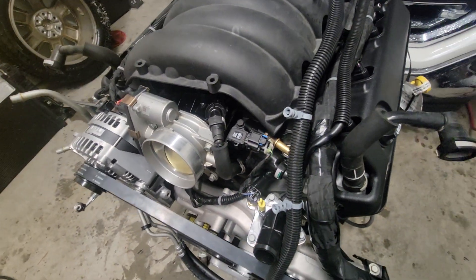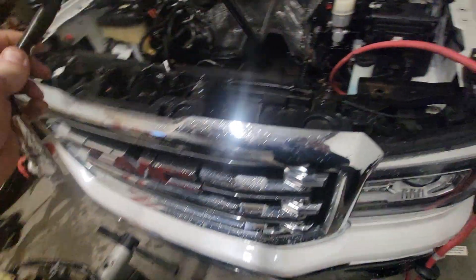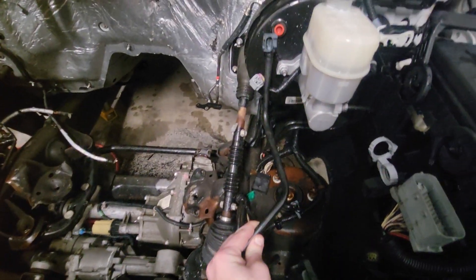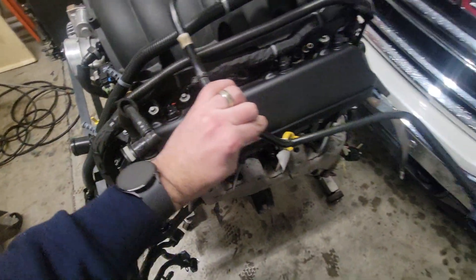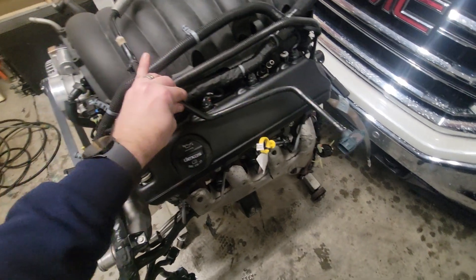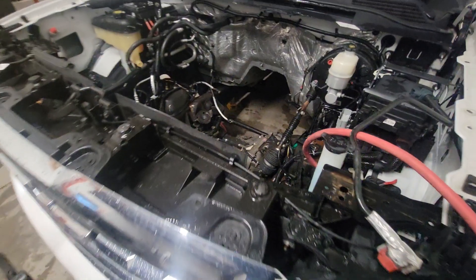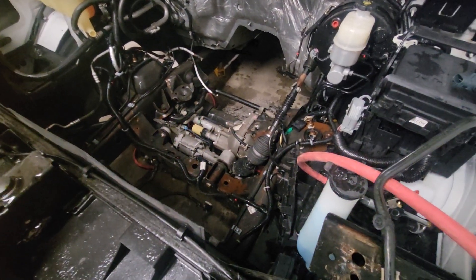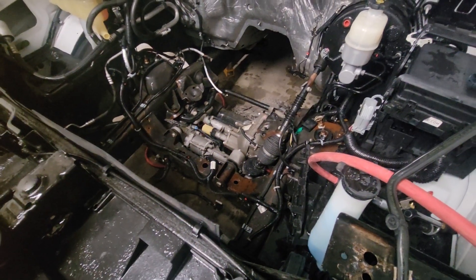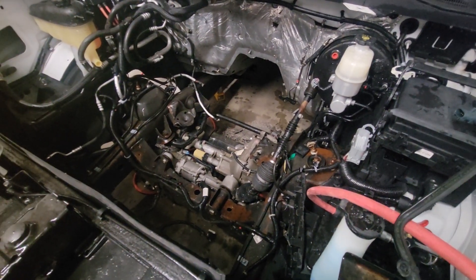There's also the vacuum manifold that goes underneath the EVAP for the brake booster — that's going to need to be modified. From the factory it plugs in up top and then runs down to the vacuum pump, but I'll get that sorted out and modified as well. Hopefully in about another week I'll have the engine in, the transmission apart and back together, start a tune on it, and fire it up. Stay tuned — subscribe, and I'll have another video up in a week or so. Thanks, bye.